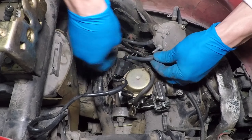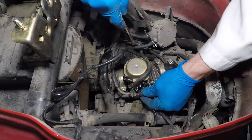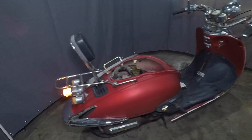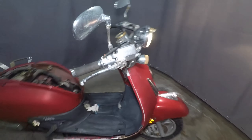Alright, let's put this carburetor back in. Bolt down the manifold first then hook up all the stuff — you'll have one fuel line, at least two vacuum lines, an idle enricher wire, and of course the throttle cable. You can pause the video here to see what all the things are. Let's make sure that throttle works — and it's good. I filled the tank with some fresh gas and now we can find out if this engine wants to run. It's turning a bit faster — and it started. Honestly, I'm a bit surprised. This is awesome. She's a runner, folks. There's something rattling in the tail light — that's funny. This scooter looks like shit but it wants to run. Most of the lights, including the headlight, work. And look at that — the eagle's eyes light up. This is so good.